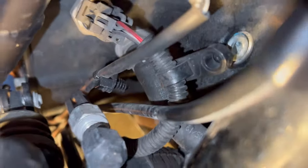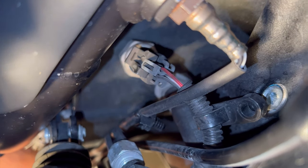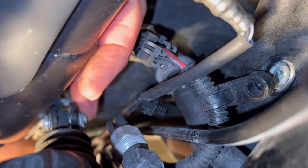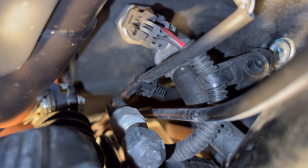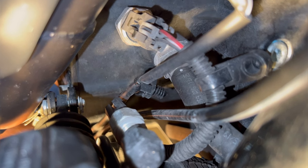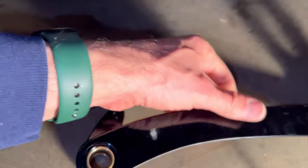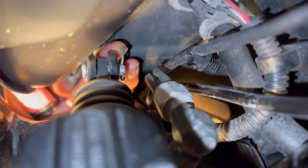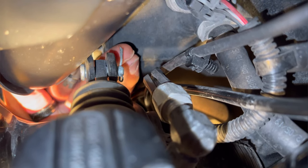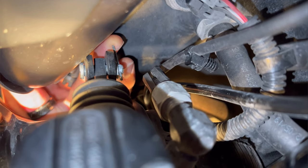With the reservoir moved, we can get down here. I'll go through the front to access this cotter pin right here. I need to pull this cotter pin out so that way the pin will come out the other side and the brake lever will come off. That pin is going through right there — this is such a small cotter pin you can almost do it with your fingers. I'm going to push it out and then pull the pin out.